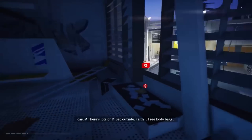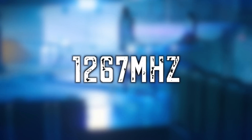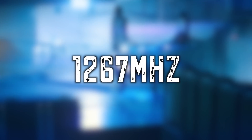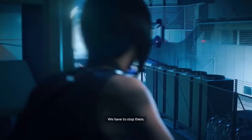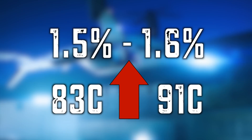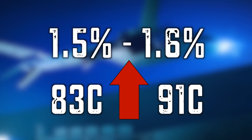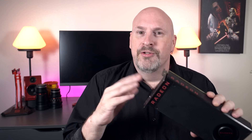For those wondering how the 480 boosts: in most games we saw the card running at about 1,267 MHz. When it came to overclocking though, the results were pretty shoddy. With just a 1.5% overclock, the card shot from 83°C all the way up to 91°C, and if we tried to push it any further than that, the system would actually crash.